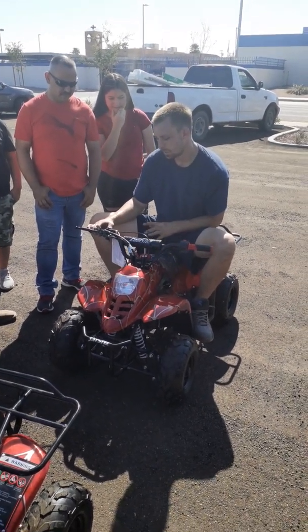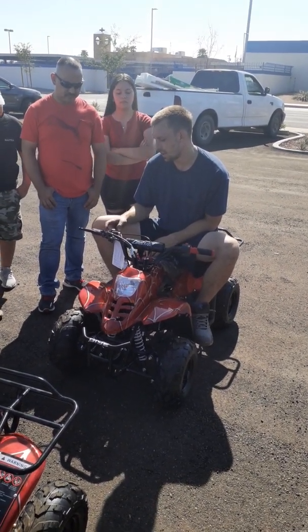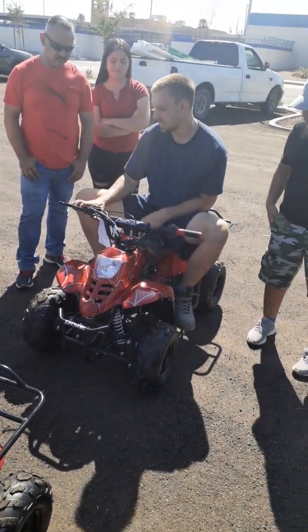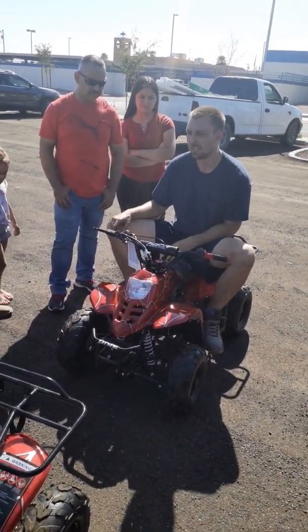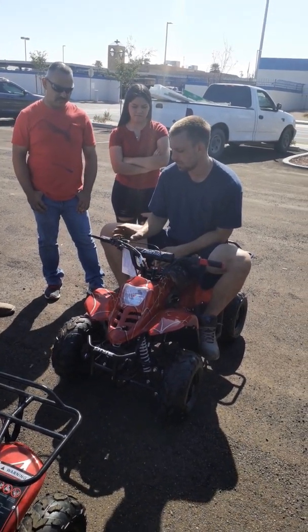And that's one thing that you want to be careful of with these, is as the adults, you want to get on them, take them for a test drive, and don't just turn this all the way out or take this screw out, because these engines can be over revved. If you take these out or turn these all the way out, and the kids get on here and floor these, that's like getting in your vehicle, jumping in the HOV lane, putting a brick on your gas pedal and just taking a nap. Sooner or later, something bad's going to happen. So do not remove the governor screw.